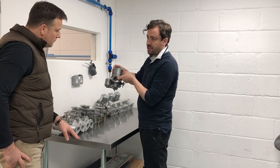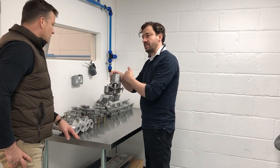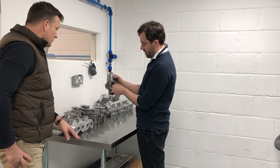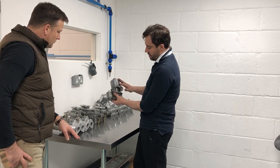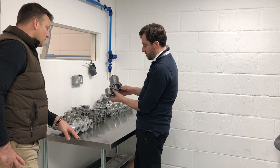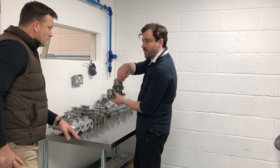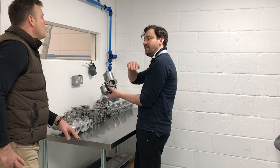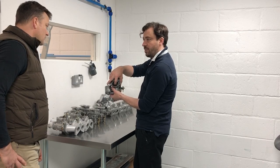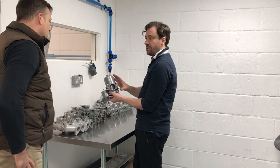One of the things about the way this works is that this is damped to ensure that as the throttle demand is created, this lags very slightly. So as this rises, the airspeed through the venturi is quite high. As it's in the transition from part throttle to full throttle, you've got much higher airspeed through because the venturi is still partially open, and that gives you a richer mixture because it's pulling more through the orifice at a higher speed. So it's a really nicely designed piece of equipment.